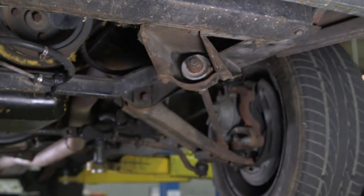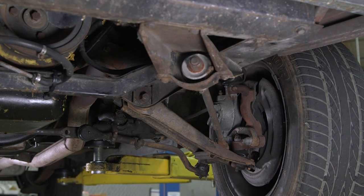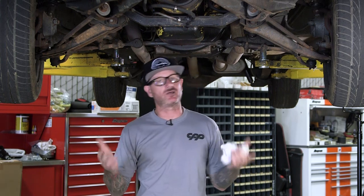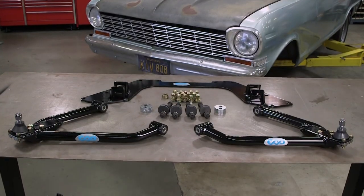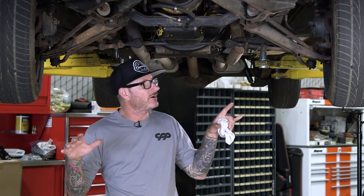I touched on the power steering — the power steering lines were cut for the assist ram. We want this car to function and steer and brake like a newer car, so I think the best option is going to be CPP's mini subframe kit, which will give us all the good geometry we're looking for and a quality ride. We are going to stick with the existing brakes because it has been upgraded to disc brakes — that's why it stopped pretty good. We'll turn the rotors and put some new friction on there, but outside of that we'll leave the brakes alone.